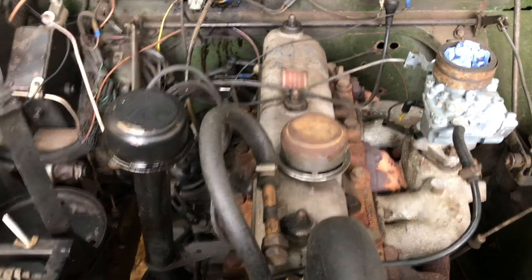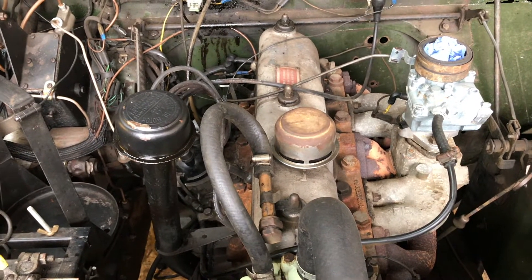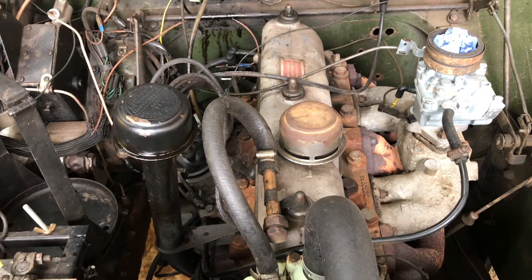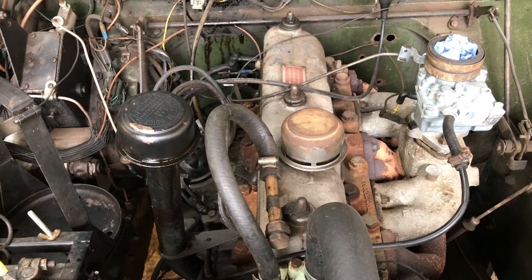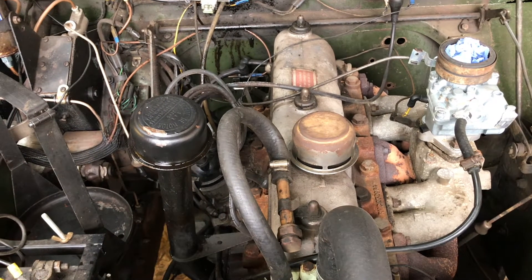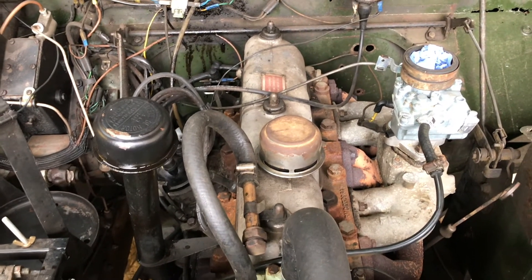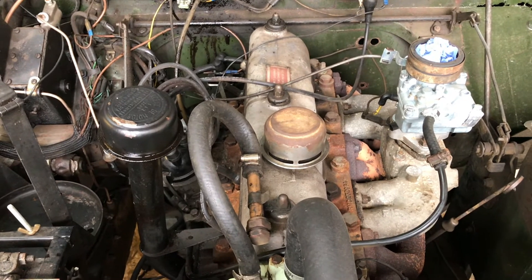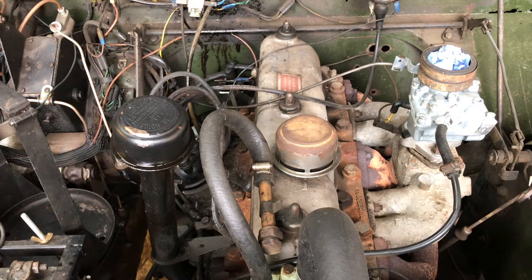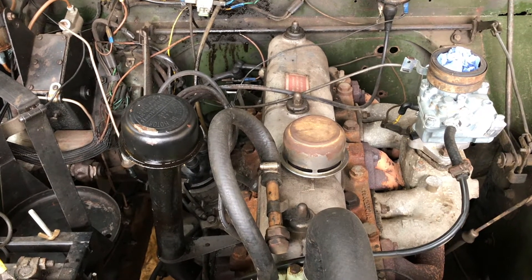But I don't know what condition the head gasket is in, and I also don't actually know if the valve seats have had inserts machined in for unleaded fuel. I would like to know both things about the engine before I go on another long run, so I'm going to take the head off, do the head gasket, have a look at the valves and anything else in the top, have a look at the pistons and the bores, and decide on an actual plan as I get into it and see what the condition of things are - hopefully sweeten it up and find the source of this crankcase pressure issue.